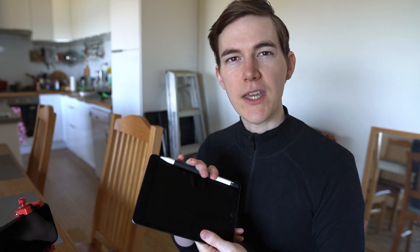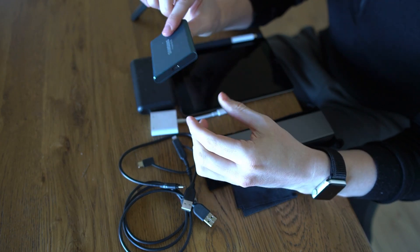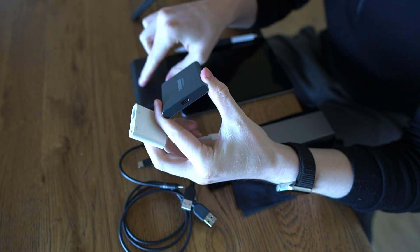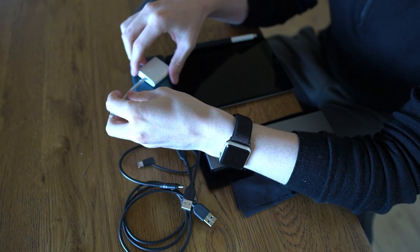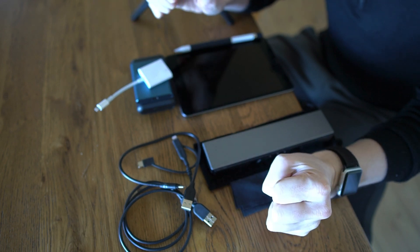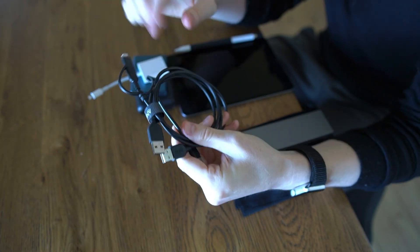When you're using the iPad Mini for any kind of work, you'll probably want an external hard drive to back stuff up onto. I've got this 500-gigabyte SSD here, and you'll want the adapter with USB 3 and a power supply so it can supply the USB port. If you plug the SSD in without a power supply, it will say it takes too much power and won't run. So you need to plug this plus an external battery at the same time into the iPad Mini to transfer your data. That also works for transferring data from a camera or any USB thumb drive. That means taking this USB-C to standard USB cable, plus a Lightning to USB cable to power the adapter itself.